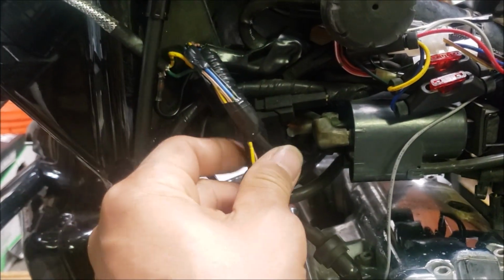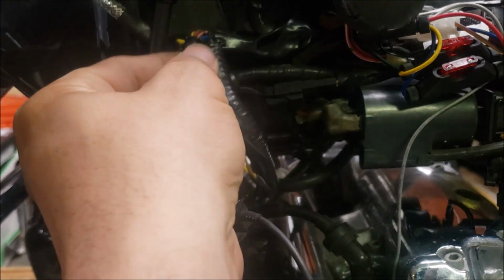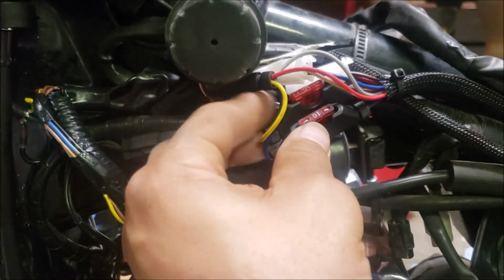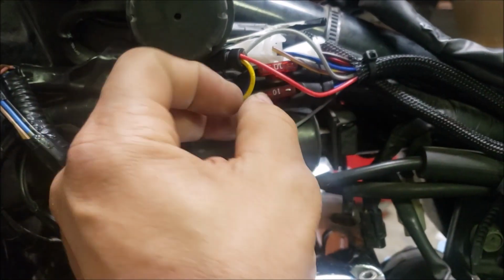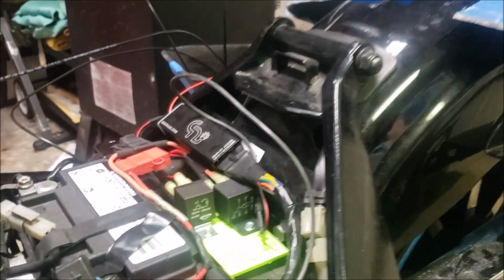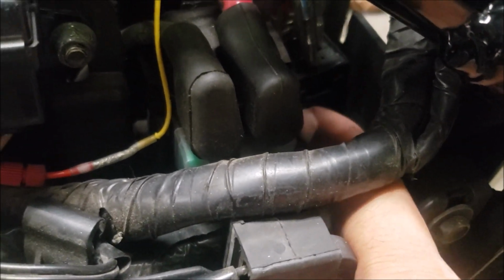While I was out here, I took, this is all of the wiring. Forgive all this stuff that's just in tape that's not even being used. So this is just kind of temporarily here, so I can decide what to do with it. Inline fuses for a couple of the headlights actually, and the connectors that I made, and this is all running back now to the Grip Ace control module, and I put all the starter wiring circuitry on a relay that's now sitting under here.